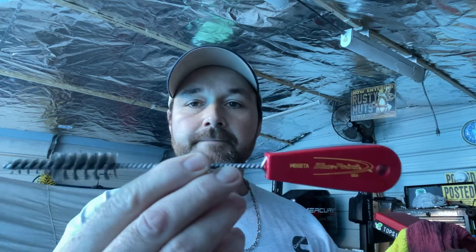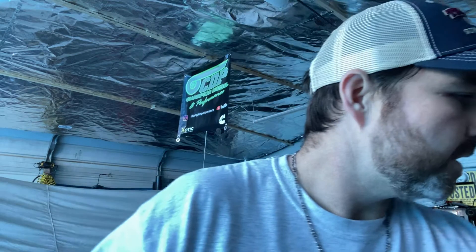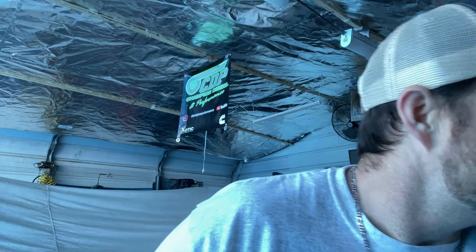This here is the Blue Point fuel injector hole cleaner - you can clean it out and everything. It'll clean down an injector bore when you pull the injectors and get all that crud out. These are always on back order and about $25 to $30. But go to Home Depot and you can get these - they're three-quarter and half inch for a couple bucks. They do just the same as this Snap-on; I actually used them and didn't even use the Snap-on because I didn't have it.